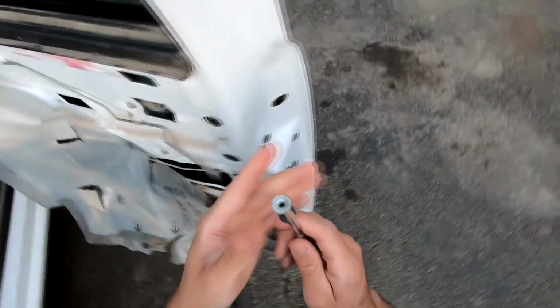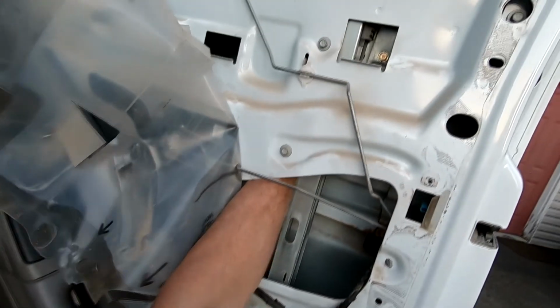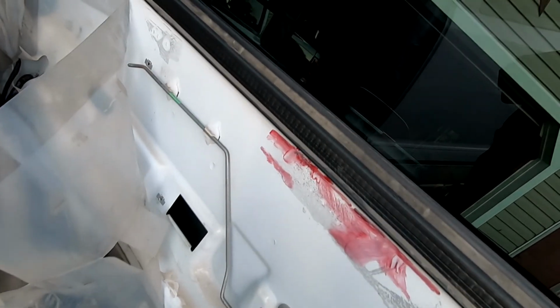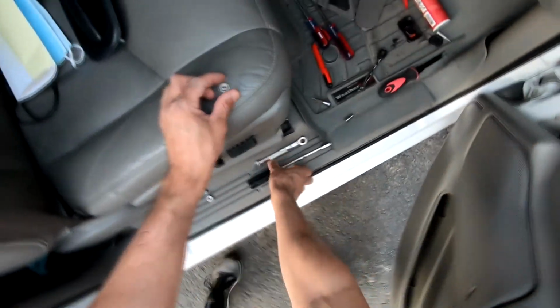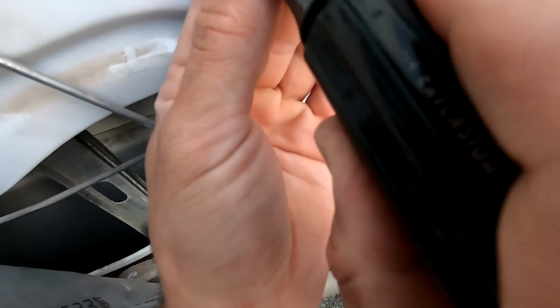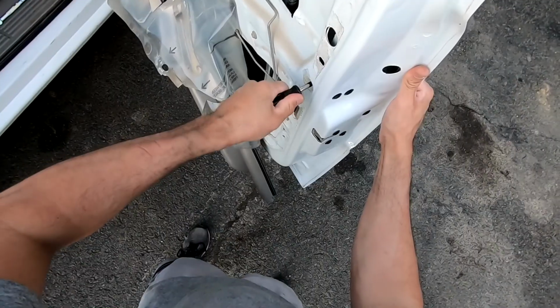Right off the bat, I'll just get this corner here. That way, for one, it's done and over with. Just snug it. Then I will reach up in, get that next one up in the corner. I like the torque spec on everything, but let's be real, it's plastic. Don't be tight. That's tight enough, it will not fall off. Then that final 8mm, then the final 10mm, straight through the guide hole. There we are. Then I'll make sure this is tight as well.